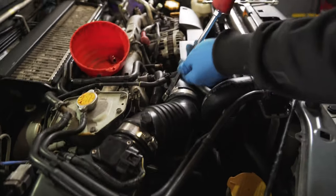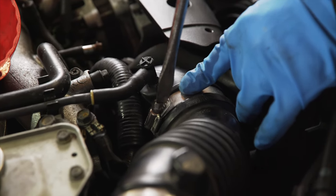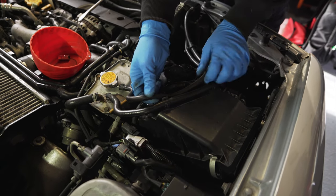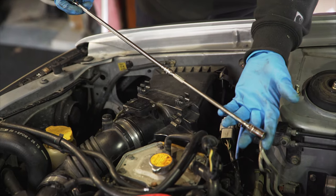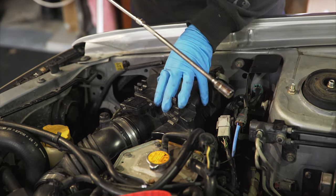First step is to take off some of the hose clamps with a screwdriver — that I forgot to mention. After the hose clamps are loose, you want to pop away your coolant hoses from the top of the air box. Then disconnect your mass airflow and tuck all that to the side for now. Next, take your 12 mil socket and a couple extensions and take out the two bolts that hold the air box down.